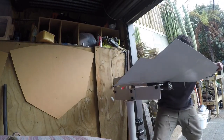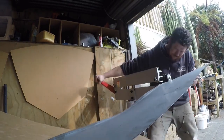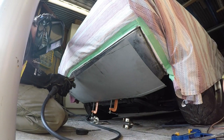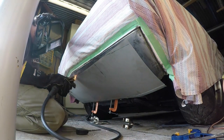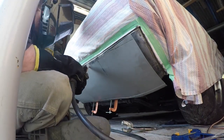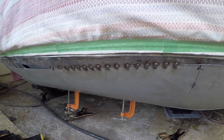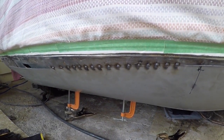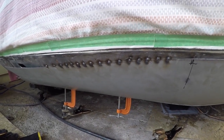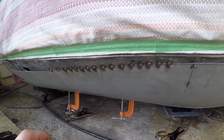It meant I was welding quite close to the seam so I didn't get too much warpage, and I was pleased with that. Once I figured out the size of the repair piece I needed, I rough cut that out — and here is where I'm pinching some ideas from another YouTuber. He's a Canadian — Fitzy's Fabrications. He's done a bunch of rust repair videos and he's clearly very good at it. So I've pinched his ideas. Thanks a lot mate — being used all the way in New Zealand from Canada.